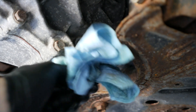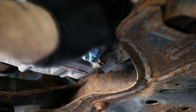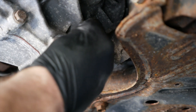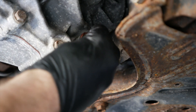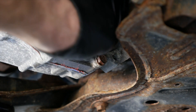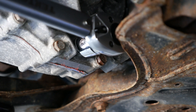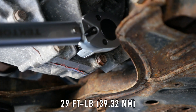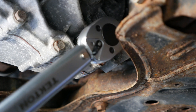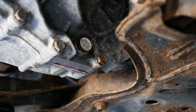It's time to reinstall the plug. Just wiping off the area and making sure that surface is clean so that everything screws in and adheres right — we don't want any leaks. I'm putting in the plug with the new aluminum crush washer, screwing it in, making sure nothing's cross-threaded and it goes in smooth. Then we're going to take our 24mm socket on our torque wrench and torque this down to 29 foot-pounds. I took this from a Haynes manual and found this spec online as well. You can hear the click — we'll do it twice for good measure. The drain plug is done.